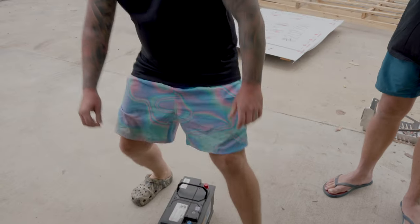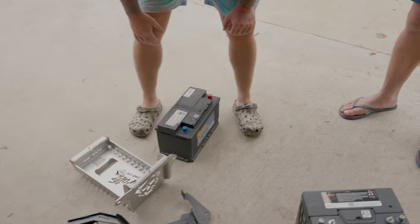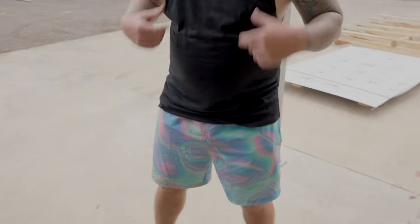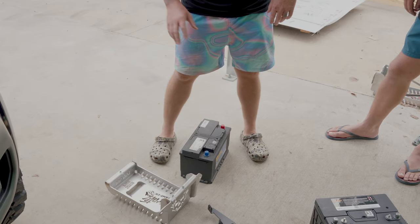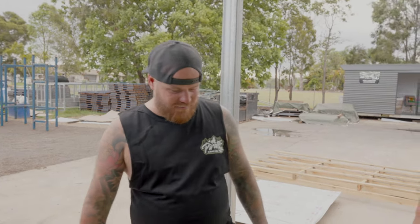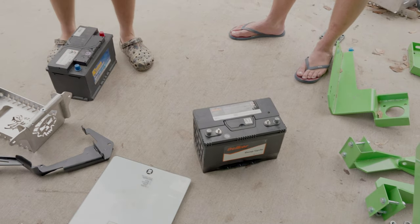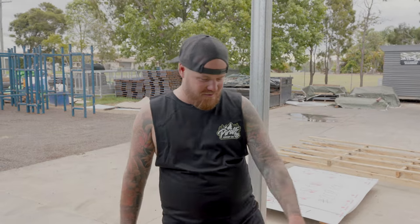This one here is a Century DIN 75, and by the way check out my psychedelic pants - new ones. Anyway, the DIN 75 weighs 20 kilos - we weighed it just before. The height parameters are 320mm long by 185mm wide by about 180-190mm high. We've managed to creep this one up to about 200mm but that's getting to the limits of that filler. This battery is 85 amp hour.